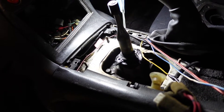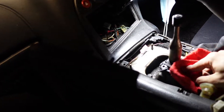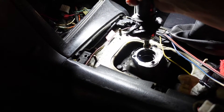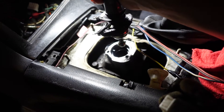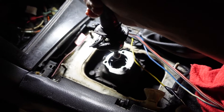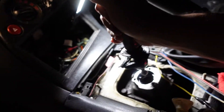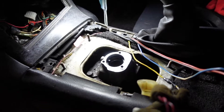After that, there were three more 10mm bolts that are honestly covered in gunk — looks like the rubber melted or something, but it's gross. Oh wow, that just popped right out. Good thing it still has fluid in there, but we need to take out any bushings that are in there because the G Racing shifter comes with one already. I cleaned up this area a little bit and now I'm going to install the short shifter.